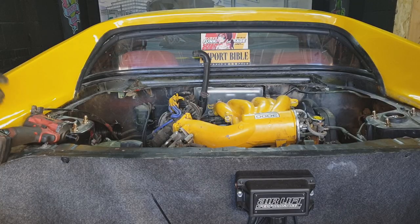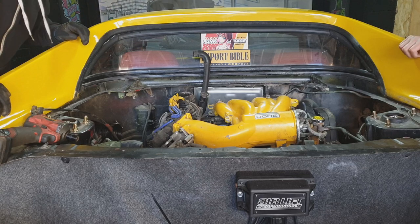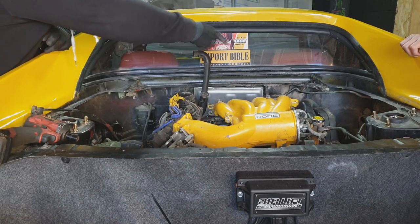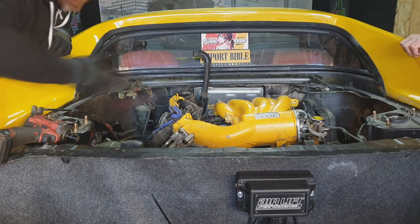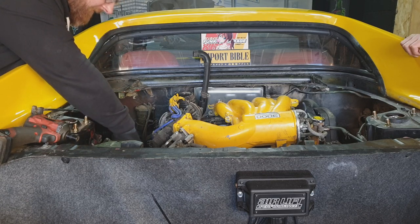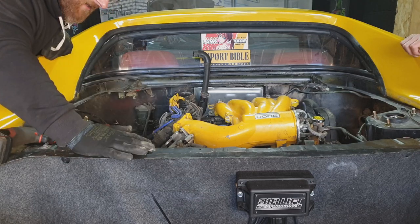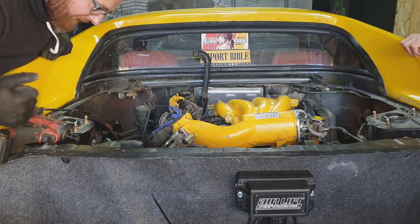As we have done in many episodes before, it is now time to do the build a bear box. So we'll go around every corner of this engine, and we want to disconnect everything that crosses that line. Driveshafts we'll need to go under and have a look at, but any hoses for coolant, hoses for fuel, bits of loom that go from the chassis of the car to the engine, they've got to either go with the engine or come back to the chassis.